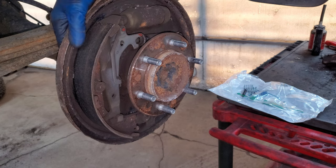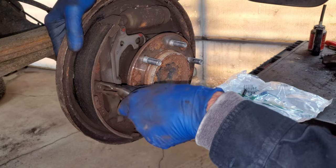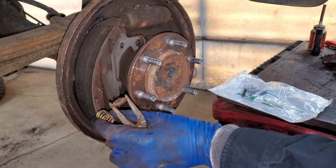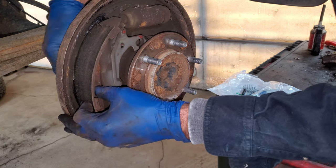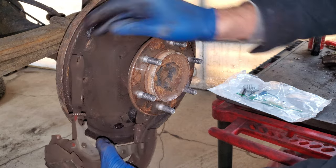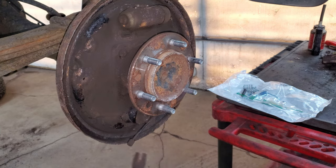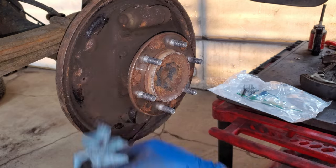There's a little spring down here holding this stuff in. On this side I've got the same deal - get this spring off. There's an actual spring tool you can buy for these but I like a small needle nose vice grip better. Then I can take this whole thing out as an assembly. There's just an e-brake cable on here I've got to take off like that.